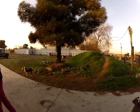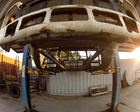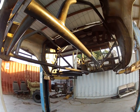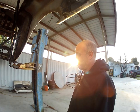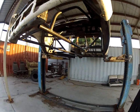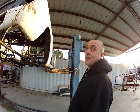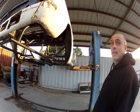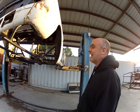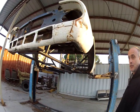Wish I could take advantage of it. I'm going to do this though. This is what I'm spending my time on. The 632 is going to be in there. It's got a JW kit. 14 and 3/4 to 1 compression. Real simple. It shifts at 7,700 RPM. Motor's good to 85. That's crazy. I know, it's psycho, huh? How big are those pistons? They're 4 5/8. Wow. Yeah, they're huge, man.